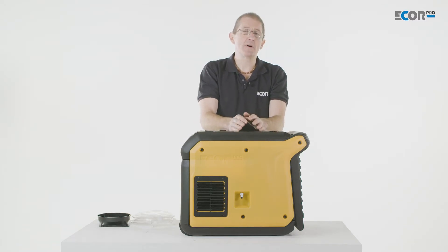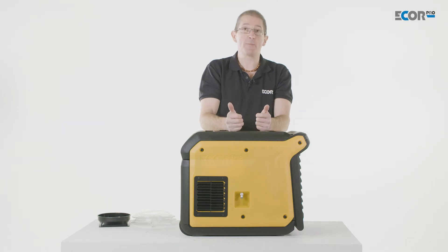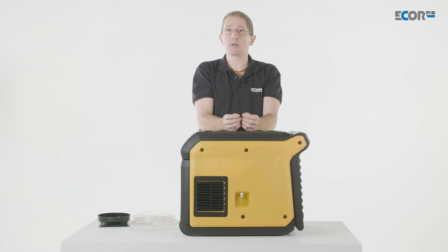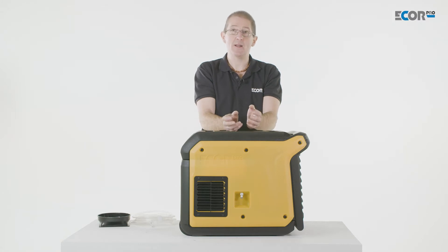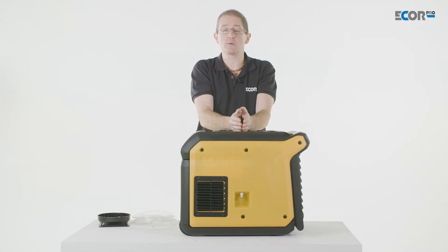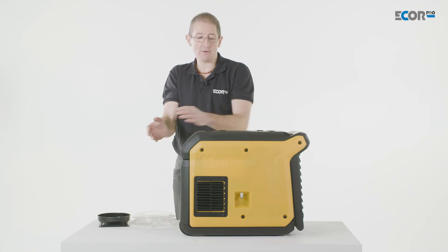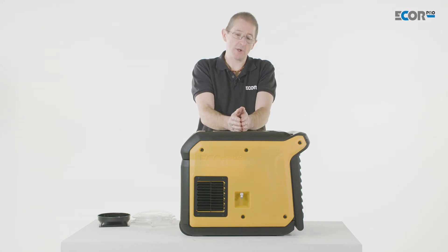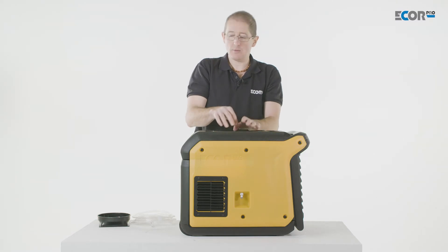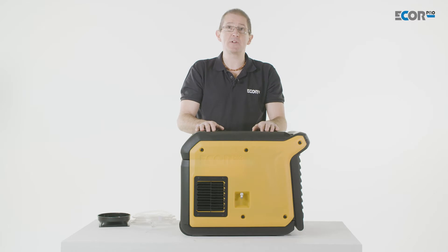Most of us have seen this before — it's like a cold milk bottle from the fridge or a wine glass with condensation gathering on it. The inside of this machine is basically like a cold lager glass. It cools the air down until it can no longer carry the moisture at that temperature — that's the dew point. All the humidity in the air is then deposited on the cold coil surface, dry air carries on through, and the water is deposited into a container where it can be pumped away.